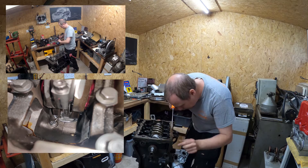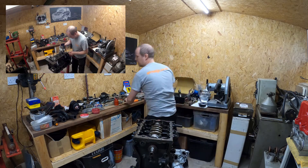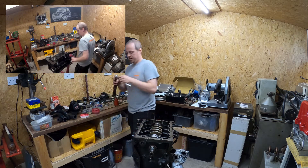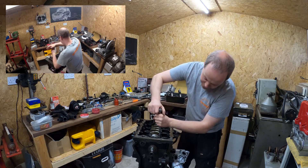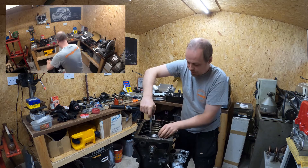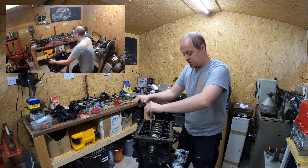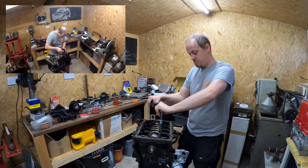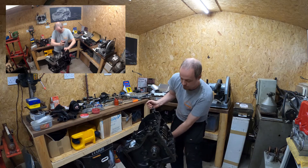I like to keep the squirters loose so I can tighten them up later as needed. With that in place I can position the oil squirter exactly where I want it relative to the piston, then lock it in. Now, using my small torque wrench, I'll tighten these up to 25 foot-pounds — we'll call it 34 Newton-meters for this instance. Once they're tight and torqued up, I'll get my angle gauge to take them to an additional 55 degrees — so it's a torque-and-stretch affair.